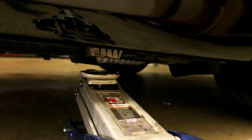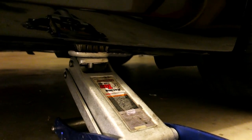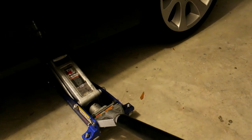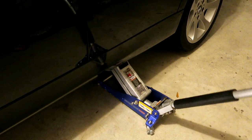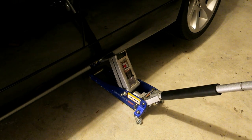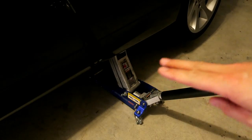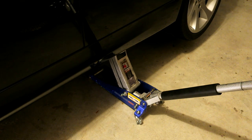So we'll get set up at the rear now and jack up the rear. Just to show — that's the condition of my jack pad doing it this way. It's not deformed or anything; it's in good shape and you get a nice contact patch using this type of jack. Those small bottle jacks or smaller jacks with a small contact area may require the puck. You can buy one of these jacks for about $80 at Harbor Freight. And while I'm jacking up here, based on my jack stand placement, I won't see my jack stand skipping around or moving. It doesn't tilt or pull away because of where I place it — it stays dead flat on the ground. I can go around all four corners safely and not have the jack stand shift and move. That's why I like this method.